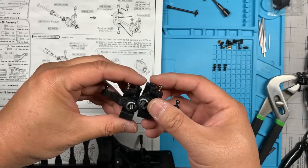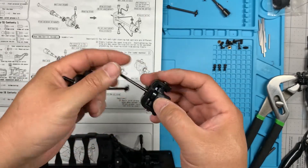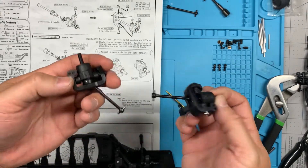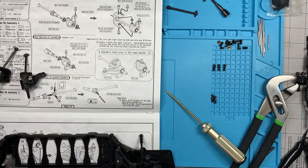Make sure there is a collar right there where the top kingpin meets the steering block. Don't turn the screw too tight — you want to leave a little bit of gap so you have full range of motion and so the collar doesn't get squished. All right, those are the front — let me set them aside and let's start working on the back.